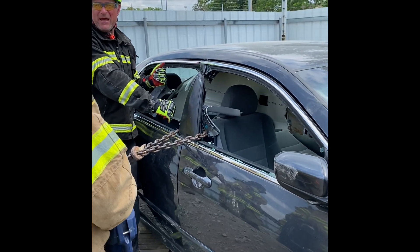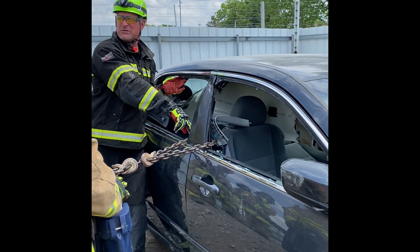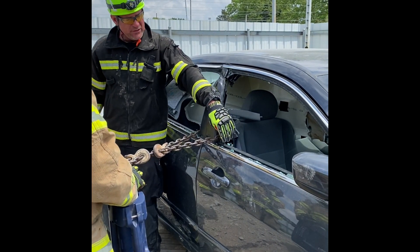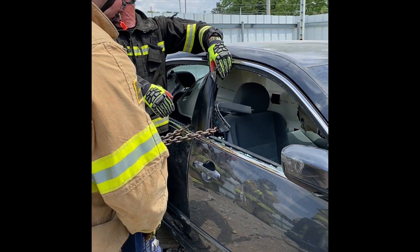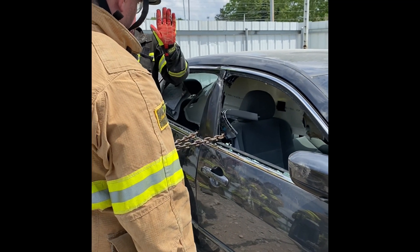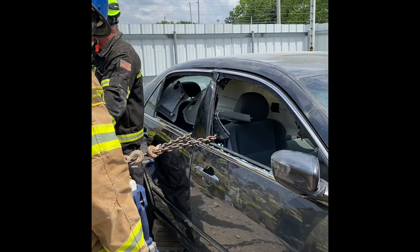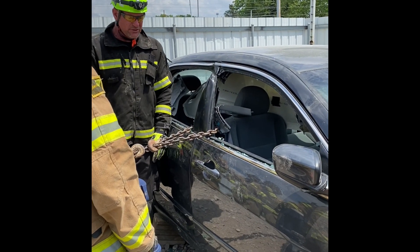My ram is going to come to the back bay. I'm going to post on the roof line and push on the B-post. To facilitate this movement — breaking and swinging out to get the right angle set for my ram — what I'm going to do in here with my spreader is a window spread. That's going to be a temporary set. The spreader comes in to help facilitate, and as soon as the ram can take the load, the spreader comes out of the equation. When I need rapid access to that victim, that zone's wide open, ram's out of the equation, and I can gain access.